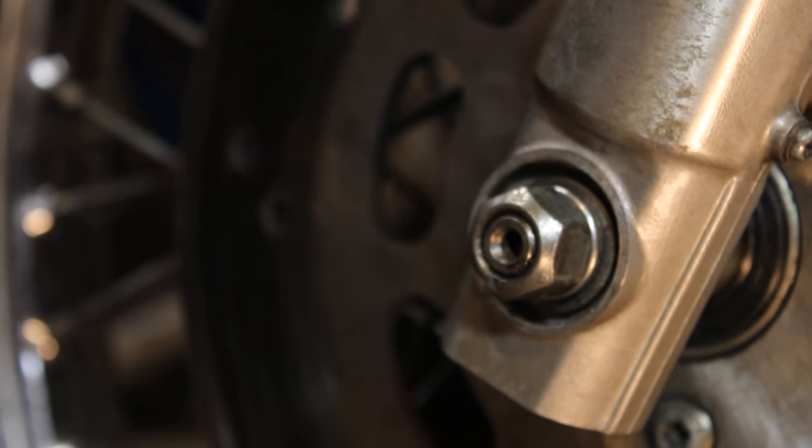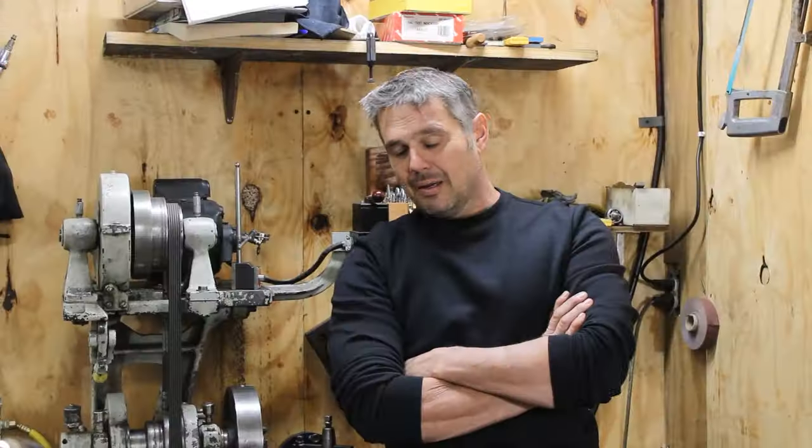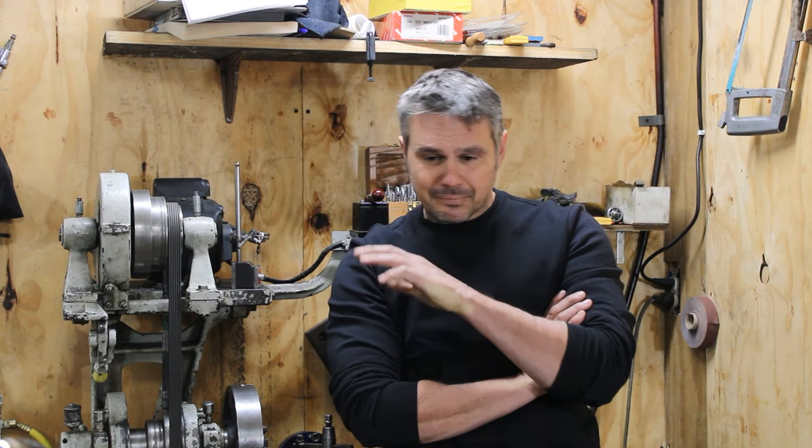See that — it freewheels better than it did at the beginning of the video. The pinch bolt is supposed to be torqued to 25 foot-pounds. I don't always do it, but if you feel you need to since it's a critical fastener, go ahead. That was a real good find. My name would probably be in an obituary in a few weeks if that bearing had come apart. That's why in my videos you'll hear me preach about exercising your due diligence — make sure your ride is maintained and tight the way it should be. Remember, you don't have four wheels and a cage around you and a seat belt like you do in a car or truck.